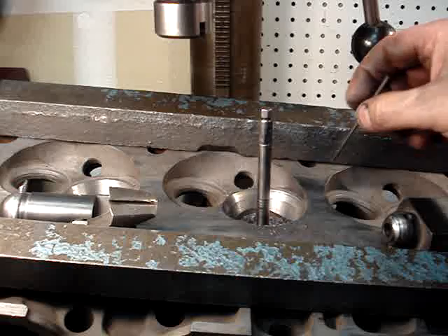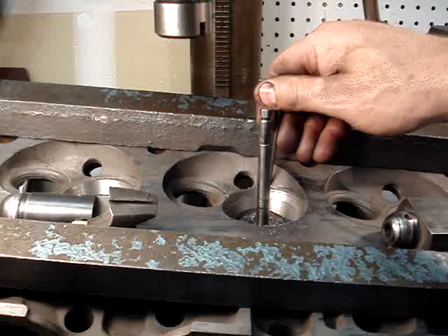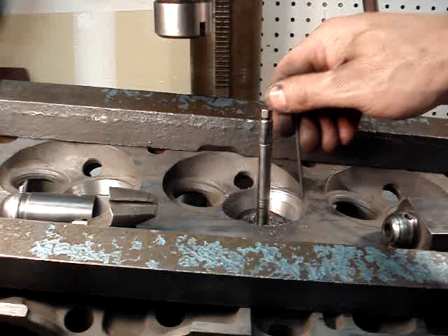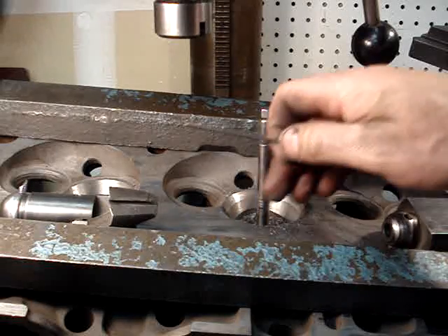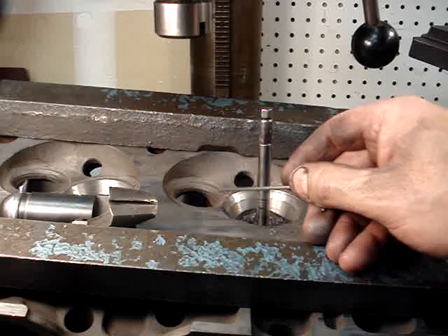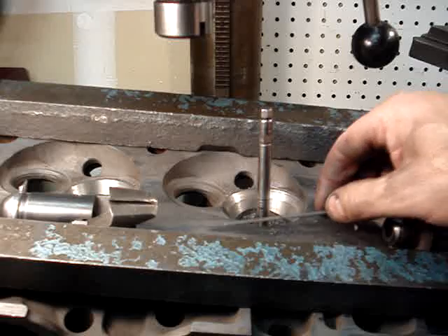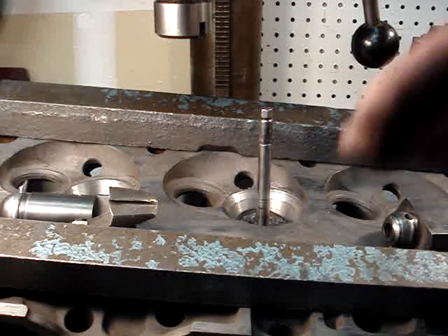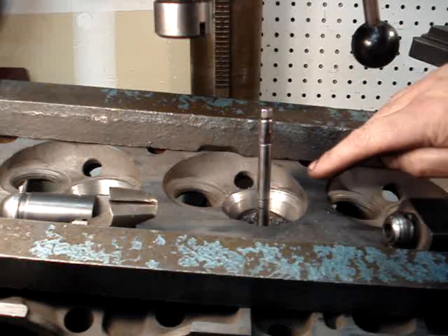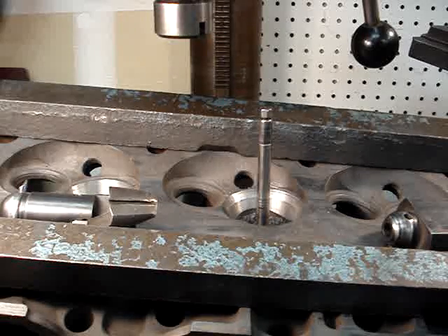So actually we have four angles. Before I'm finished, this tool that I talked about earlier — where we're going to come in here and cut some of this out — it's also going to cut the top of the seat up here at about a 20 degree angle. So we're going to have actually five angles: a 20, a 30, a 45, a 60, and about a 77 degree angle. Air flow does not like abrupt or quick changes in direction — it likes gradual changes. So if we put multiple angles here, it creates a radius if you will, and that allows the air to transition into the port much faster and much smoother without any disruption.